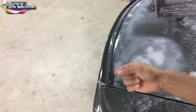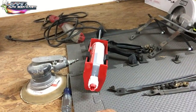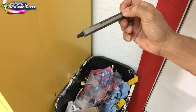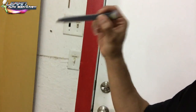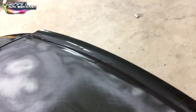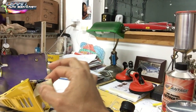This Miata project — which will be in the VIP course — I had to re-epoxy this section because when you're using epoxy with those mix tips, you have to waste the first tablespoon. Although it looks like it mixes well going through those little channels, when it first comes out you still need to waste about a tablespoon. This is a super important tip — you don't want to mess up like I did. I had to redo this area and also this broken tab here.